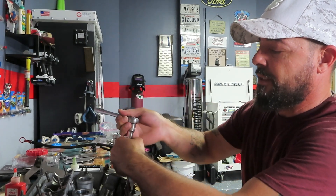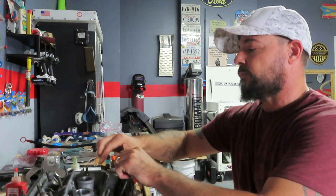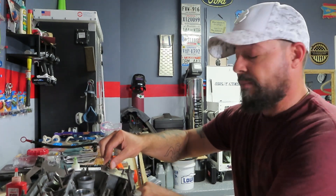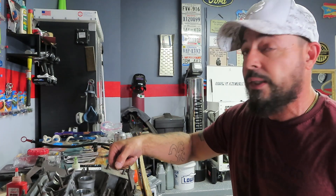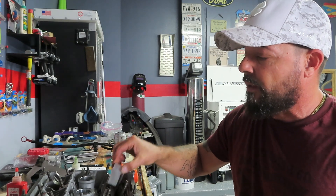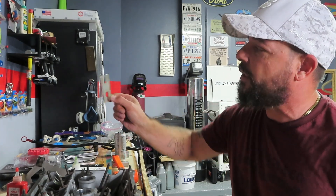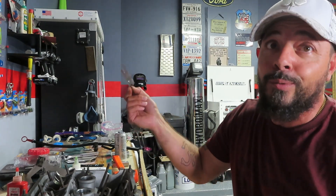See, it's already off that easy. Unscrew the pieces again. These BMW heads — because the valves are going at an angle — it's difficult to use the other valve spring compression tools. But here we go again: little piece with two holes drilled in it, little piece of aluminum block — I think this is like three or four bucks. And then this one — I drilled two holes and cut these pieces out, and it works.